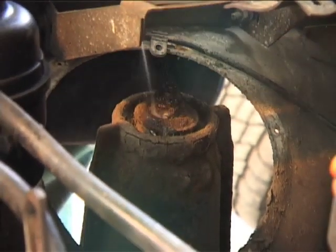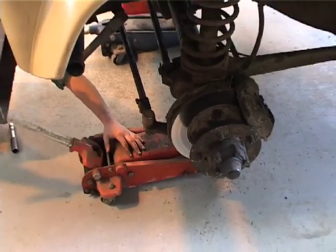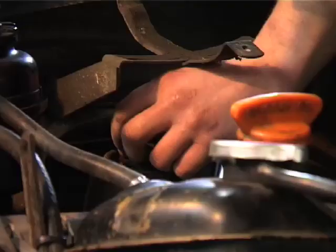Stand jacks, whatever you've got underneath the axle, okay, under the nuts with the weight on there — it's less likely to actually turn the top of the shock absorber. So you put some force on it so that it isn't going to be turning.